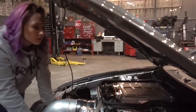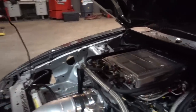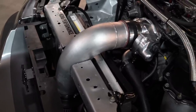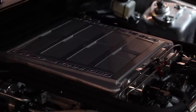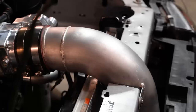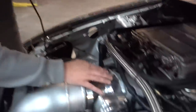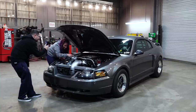Your basic cam-swap LS deal to give you a bit more power — that's why she sounds a little choppy. The blower is actually the most interesting part. It's a 2.3-liter supercharger from factory, but I want more power because basic is just not enough for me. Kong Performance actually ported the supercharger, and he ported the snout too. This is a snout that's been enlarged — he cuts it, ports it, re-welds it — and it's now a 108-millimeter supercharger snout. The throttle body is only 102 millimeters, so you can stick your fist in this hole.